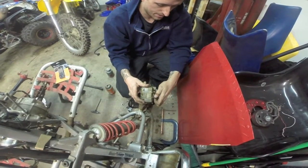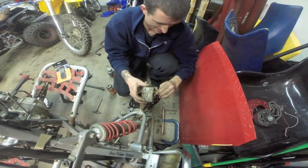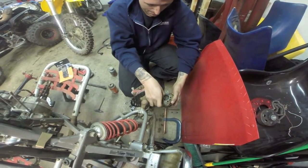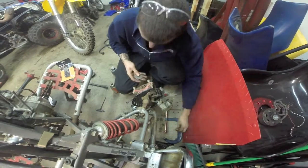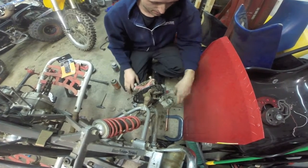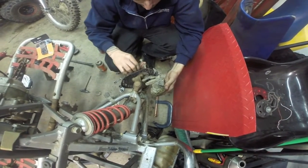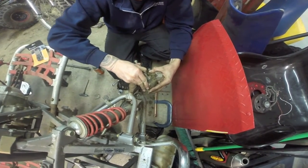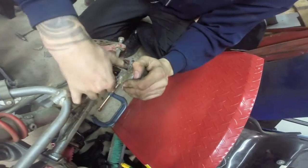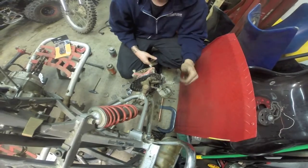Once you have your bolts threaded all the way out, just slide them out one at a time — slides right off and your brake pads fall right out. These were actually just at the end of their life; they weren't worn totally through like our other ones. So you're going to want to inspect everything in here. Make sure you weren't destroying any part of your caliper when it was riding on the disc. You're also going to want to make sure the sliders right here are working as they should. If not, you can take them apart and spray some grease in there.